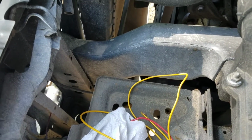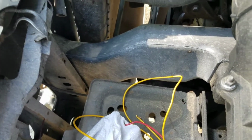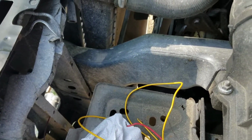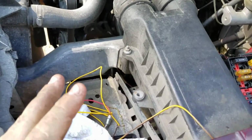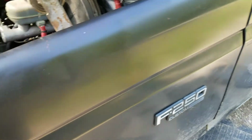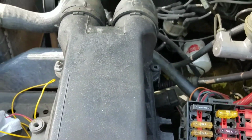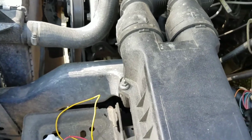As far as the reverse lights themselves, you can use a 3157 bulb, which has two filaments, and it's the ones you would use for your tail lights. But it calls originally for a 3156 bulb, which is a single filament bulb.